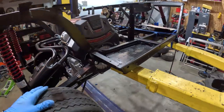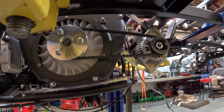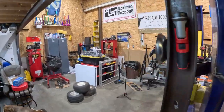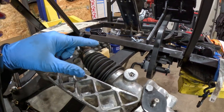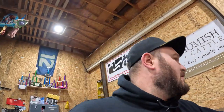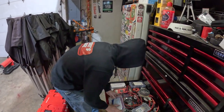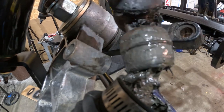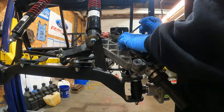Carlton got it all finished up — new upper bracket, revised lower bracket — and the alternator is all installed. Pretty pumped on that. Now I'm doing the fun part: dropped the rack to replace this joint, so a lot of fun but it's got to get done. Carlton is working on wiring up the alternator, the bus bars, the engine ground, and testing the accessory — possibly firing it up. And you can see why we're replacing this thing — the joint is completely worn out.